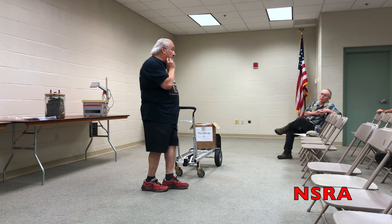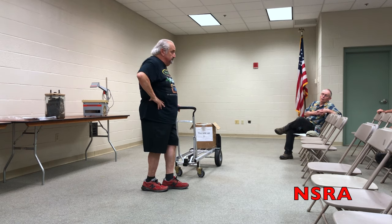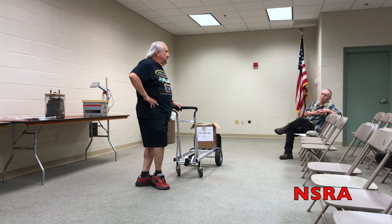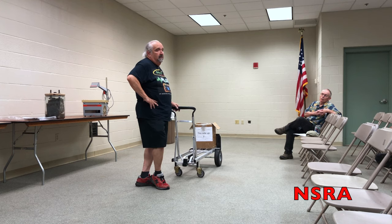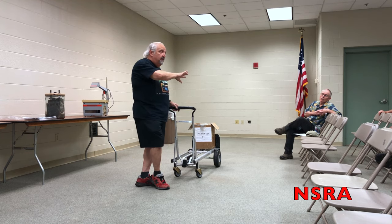So when you get a battery below 11.7, as far as functionality is concerned, it's not a very good battery. I mean, it's too low to really do you any good. So they came out with deep cycle batteries because what you're intending to do with this thing is run your lights or your load or whatever the item is for a while, as long as you possibly can. So the voltage will go down below 11.7, but most 12 volt items will run down to around 10 or 9.5, and so you've got maybe two times the storage capacity that you would have out of a normal battery. So that's why they've got deep cycles.